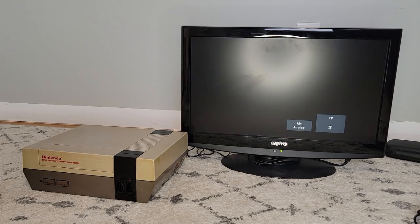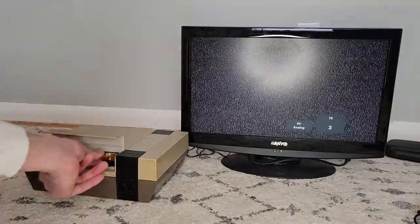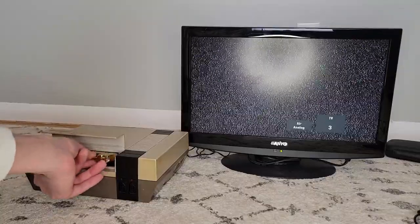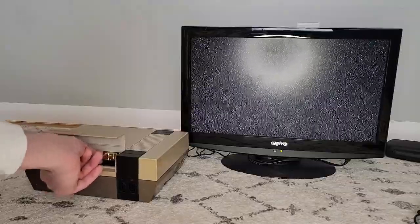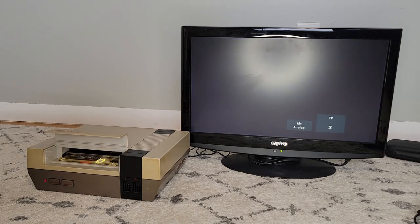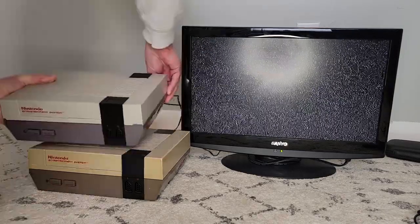This thing is not working. We get this flashing red light and it does not boot the game. I tried the basics like jiggling the game around, cleaning the pins with alcohol, etc., but it was all to no avail. The 72-pin connector inside feels loose, and there's barely any resistance when I insert or remove the game. Generally, the flashing red light means the console failed to authenticate the cartridge as being authorized by Nintendo. A poor connection to the game will cause this, so I'm fairly confident the 72-pin inside is the problem.